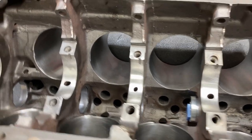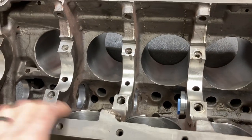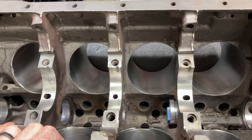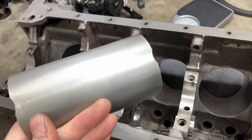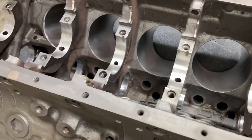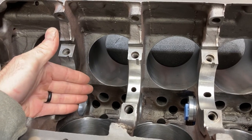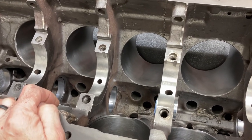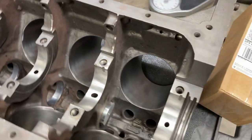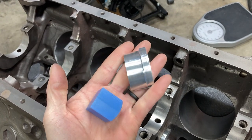The executive decision was to knock side oiler cam bearings in. I had Mr. Barrett, our expert machinist, pop me out some sheet metal without holes. That led us to thinking: how can we keep these things in place while the epoxy is setting? That's kind of the whole shoot-and-match behind all of this. Mr. Barrett whittled us out some tools, and if this goes to market, we're going to sell these tools.